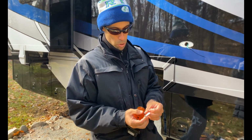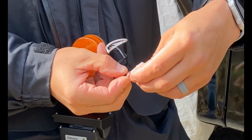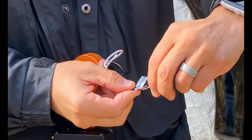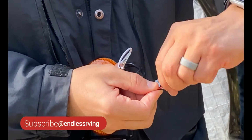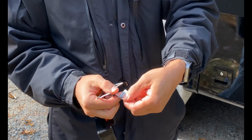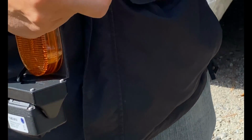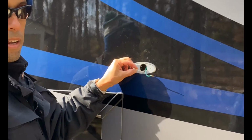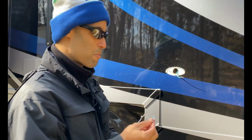These 2 wires go together. Okay, this is going to be your hot. So the black and the red are going to go together. Okay, this is going to join with the green, and then the white and the other black, which are labeled underground, if you see they're kind of bound together. We're going to put those together. Those are going to go join with the white. Okay, pretty simple, right? At least I think. We'll see how this works.